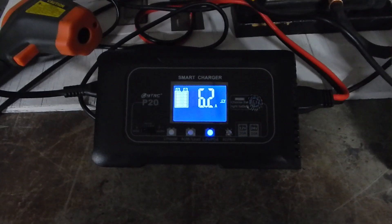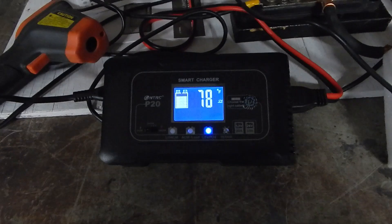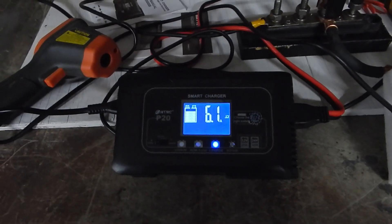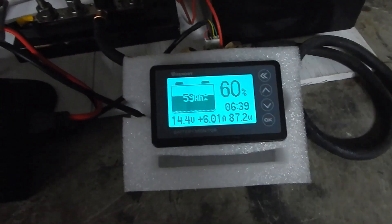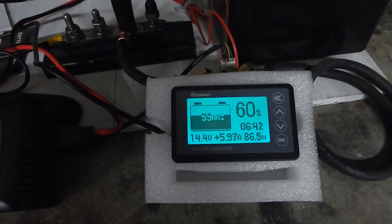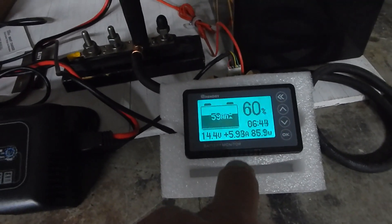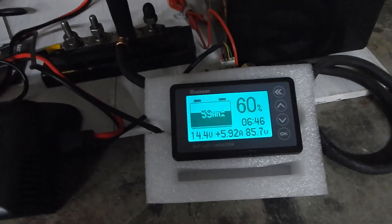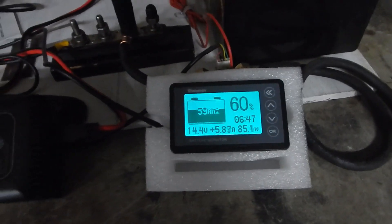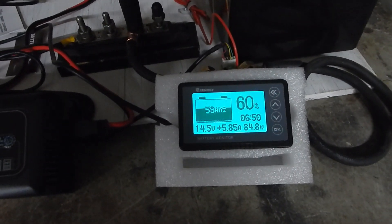The battery charger is doing a pretty good job — yeah, it's down to 6 amps too. That one says 62 amp hours, and this one's saying 59 — that'll probably kick over to 60 here momentarily. We're down to 5 amps. As long as this screen is blinking like that, the battery's charging, so it's tapering itself off. I'm going to give it a little bit longer — hopefully this will come to an end here.